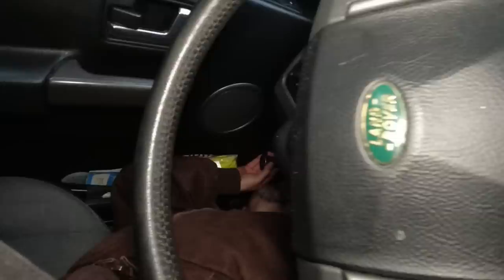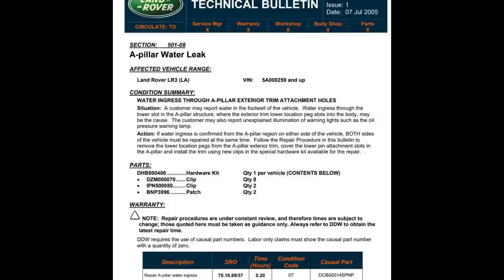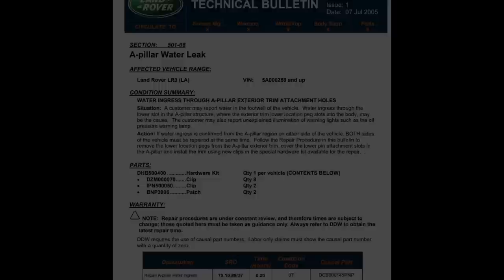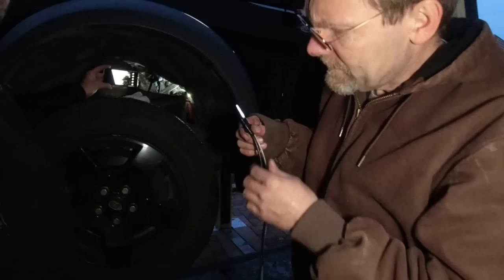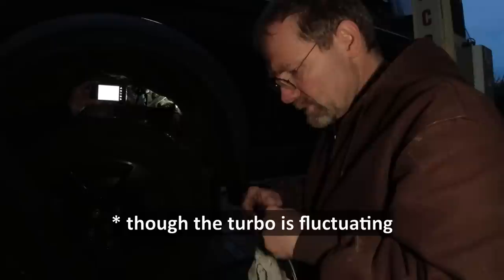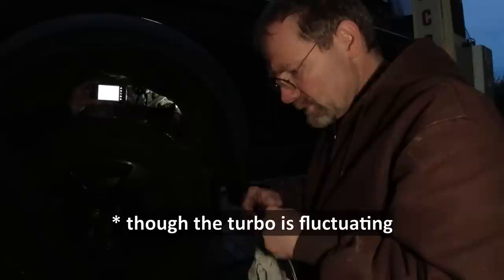I see it. Yeah? Now he's pouring in over the door again. Look at what Christian built. We got our camera here and a little spray nozzle. Do it again. Lubrication out. And we want to get lubrication onto the turbo actuator. Because we think the turbo actuator is stuck sometimes. And thank god that's an LR3 and only has one turbo.